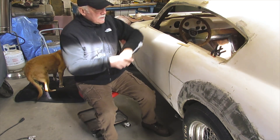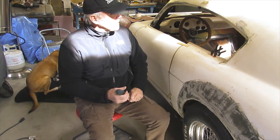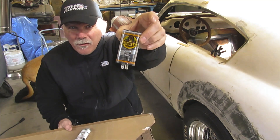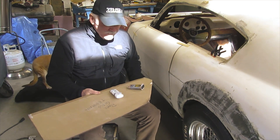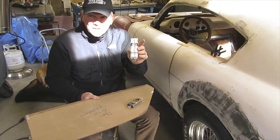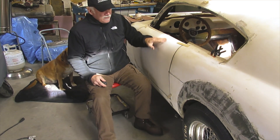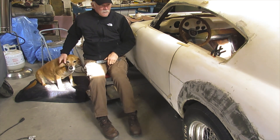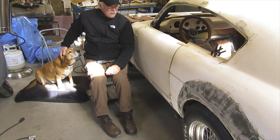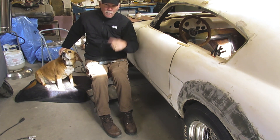I went ahead and stuck on the other door skin and epoxied that in — let's see if this goes any better than the other side. When I did the passenger side I used Gorilla Glue five-minute, but it got a little cold in here last night and maybe it didn't set up that well. I went ahead and got the JB Weld instant-set and tried that on this side. The other thing is this door shell fits a little better on this door — the other one was really warped, so there was a lot of tension on it. As I was trying to twist it back into place and released the clamp it kind of popped out, so I went ahead with the JB Weld and restuck that one, then let the pressure off from the inside before trying to pull it into place and fiberglass it.